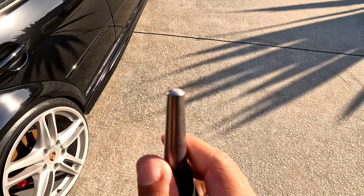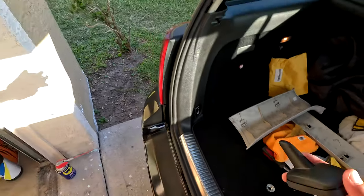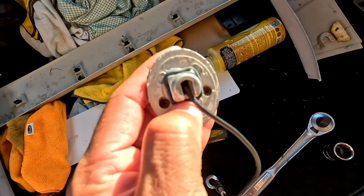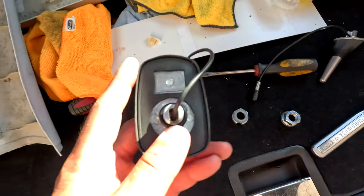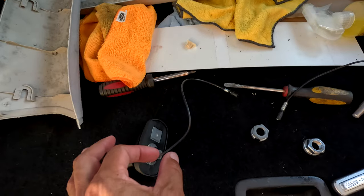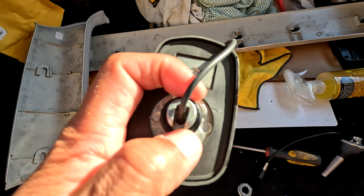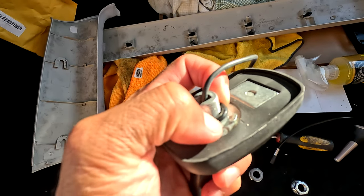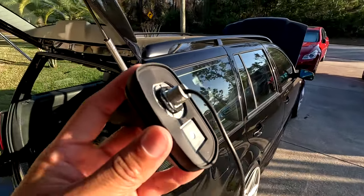This was an ECS Tuning stubby antenna I got from the junkyard two or three years ago - looks cool, but the shark fin adds a nice clean touch to the roofline. Quick thing to note: the old one had a square silicone seal around it. On the new one there's a round O-ring which is far too thick to fit down through the hole in the roof and mate up flat. So I had to push the O-ring all the way down flat around the bottom to make it square, then super glue it down in place. It'll fit but it won't stay on its own without that fix.